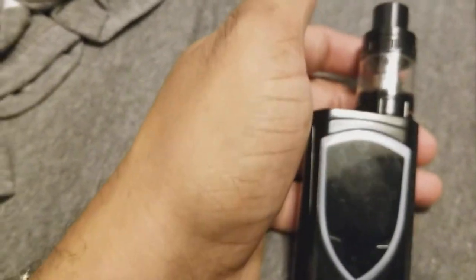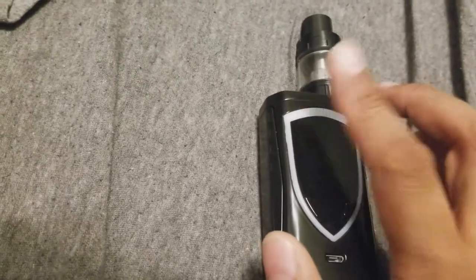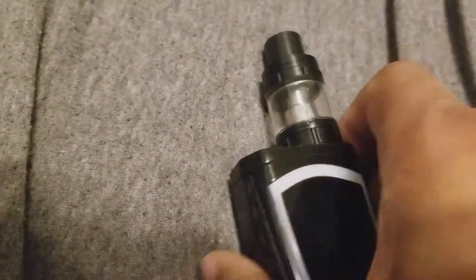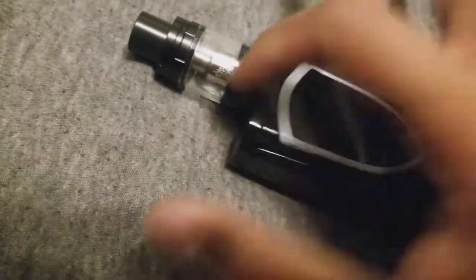Now as for the atomizer short — this is the Smok Pro Color 225 watts. The single coil is what I put in first. It was fine after the first tank, but when I refilled it: atomizer short, atomizer short, atomizer short. I tried the quick fix of just loosening the top — had it say atomizer short, unscrewed the top slightly, put it to my mouth, pulled the trigger, and a flame shot out maybe this far. It scared the hell out of me. Find the root cause of your problem — quick fixes do not work.